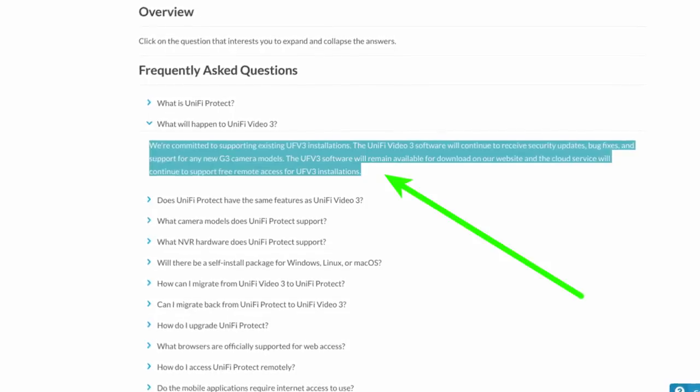The good news is UniFi has stayed with their commitment to keep pushing updates for the UniFi Video platform. So if you're in the market to buy something right now — which should you buy? Because of the support, and because they seem to have laid out a roadmap for the Cloud Key, you can base your decision on that. The UniFi Video software is still supported, still free to download, and you can still run it on your own hardware, in a VM, or however you want. They plan to continue bug updates, but no more new features. And because it doesn't call out to any licensing server, it can sit there and run pretty much indefinitely without a problem. So that is not necessarily a bad solution.